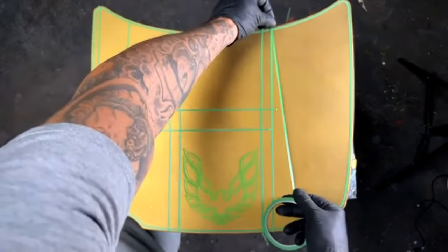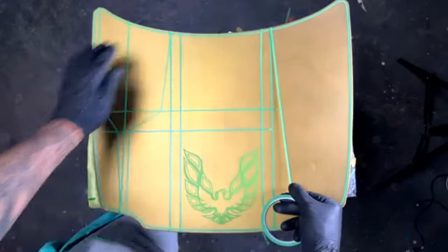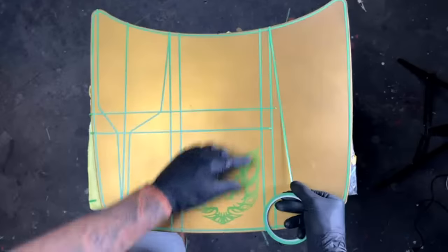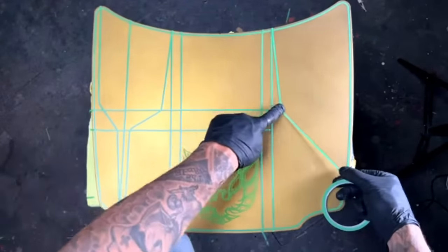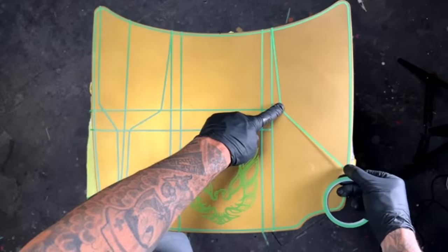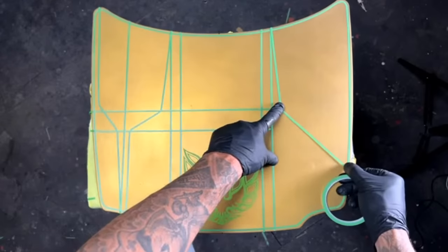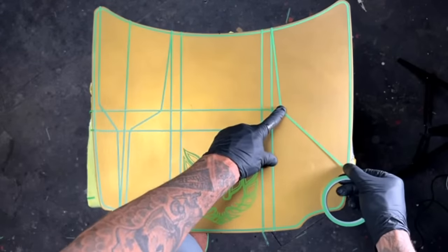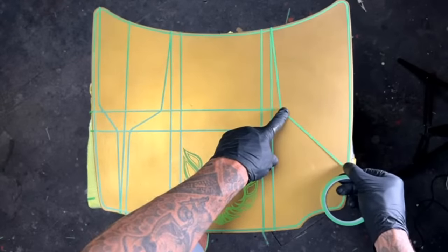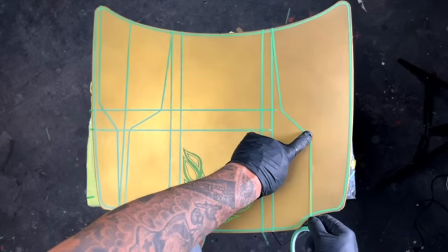Douglas said, I asked last week about doing a sealer over the fiberglass on the bottom of my Superjet. Your mic was cutting out when you responded. What would be better, a primer sealer or epoxy primer? And what's it on again? Fiberglass on the bottom of my Superjet. Epoxy is going to be the toughest thing you can lay down. You don't have any problems with corrosion because it's on the bottom of a jet ski, right? Superjet? Yeah, I'm guessing. So, yeah, I would go with epoxy, but remember, it doesn't sand as good.